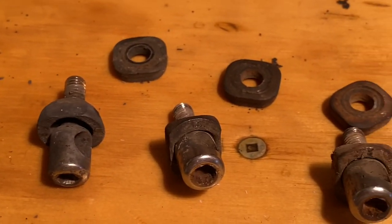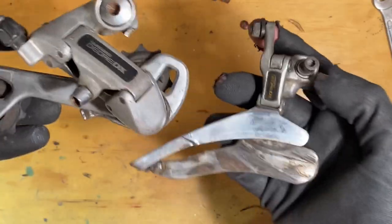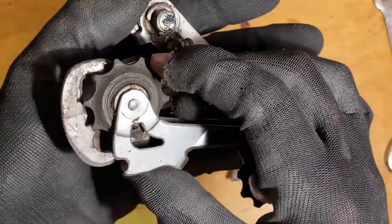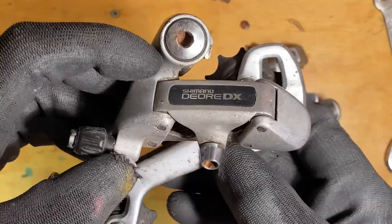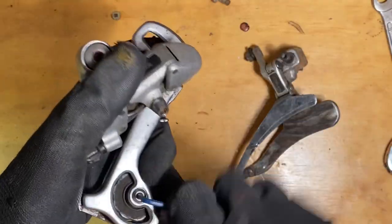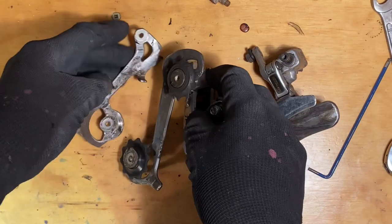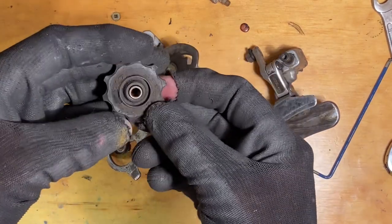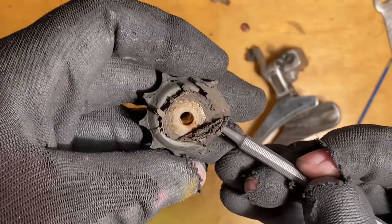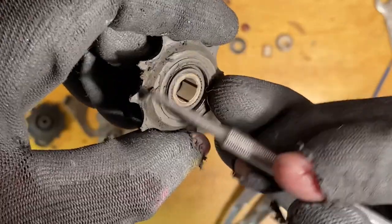I've got a small pile of parts that need to go into the VapourRust - just a few nuts and bolts from brake parts and some things from the derailleurs. I think the jockey wheel needs replacing - pretty sharp teeth on it. This cable anchor nut will go in the VapourRust too. After the VapourRust you just wipe it off and then either clear coat it or coat it with some oil to prevent rusting again. There's something so satisfying about cleaning jockey wheels - I don't even need to clean this one because it's being replaced, but it's just so satisfying.